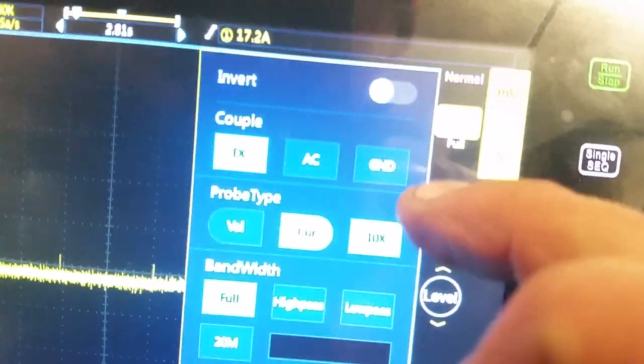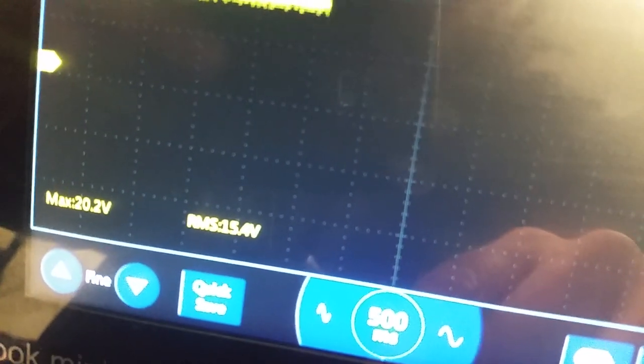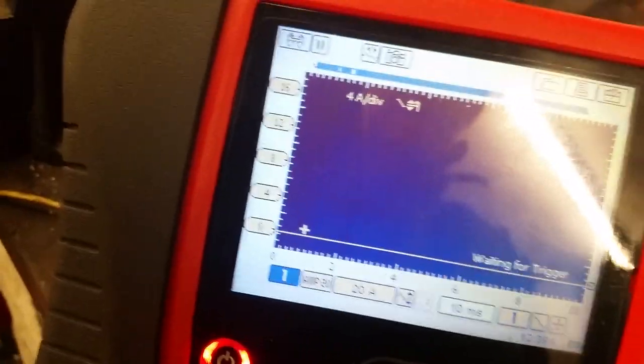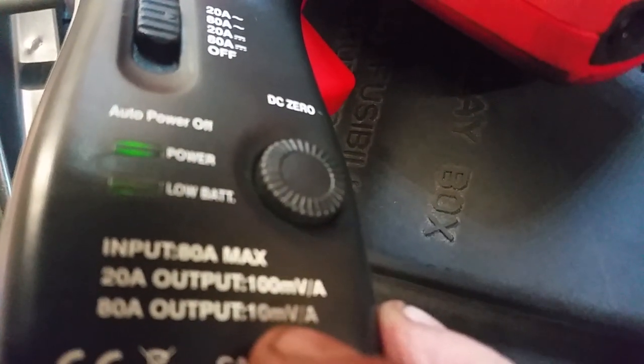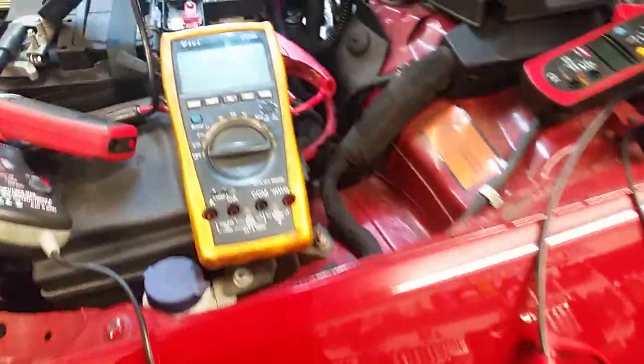I could simply make the scope read actual millivolts — it's actually reading 15.4 volts because I've got it set on times 10 to do the calculation for me. The Vantage Pro has a 20-amp and 40-amp low amp probe setting built in. This Sealey clamp here is 20/80 rather than 20/40, but if the 40-amp setting on the Vantage is 10 millivolts per amp then it'll work fine.